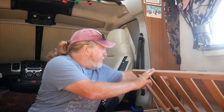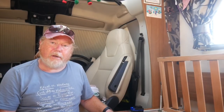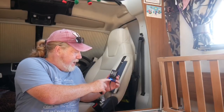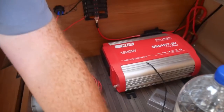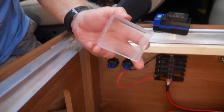There's the remote control - just fitted up there - cabling run down and into the under-sofa covered area. I've also wired up a fuse box and common earth bus bar, and I've got one of the power outlets already working. So I've got my camera battery charger down here and that's working. Let me show you how it's all fitted in - it's all still work in progress. That wire is the run to the accessory ports - the USB and the 12 volt outlet.